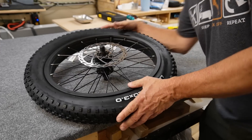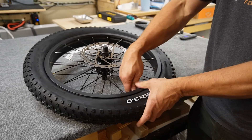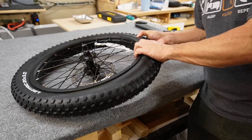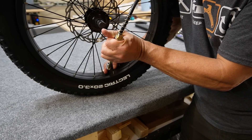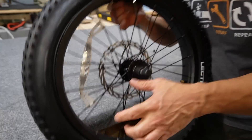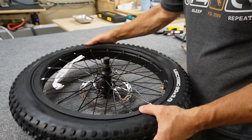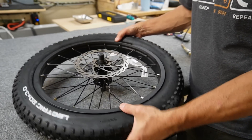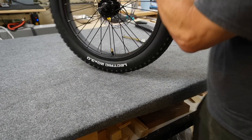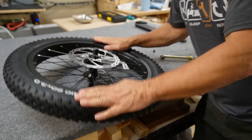Since we're putting on a new front tire, I'll go ahead and put a little air in it first so it's not completely flat when I mount it on the bike. I'm going to do this in a couple of stages — you want to make sure that this bead, the edge here, is inside the rim; it has a tendency to pop out when it's partially deflated. So look all the way around on both sides and make sure the bead is nicely seated inside the rim before finishing it up.